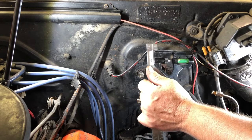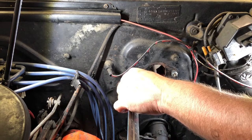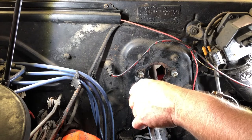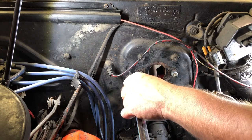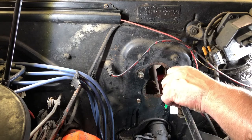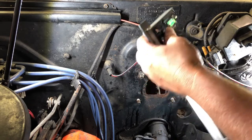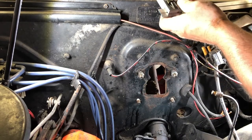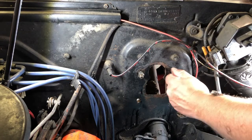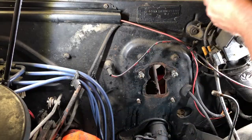They are like 9/16 or whatever. Oh, geez. These ones are way longer than that. So what I'm going to do is back that nut to 9/16, and then take a die grinder with a cutoff wheel and cut the studs. If that doesn't work, we're gonna be in a pickle. Okay, see how I did that?